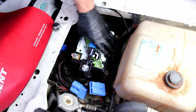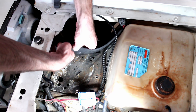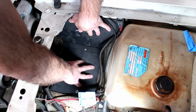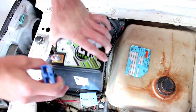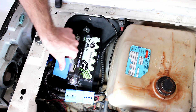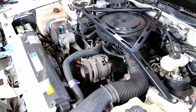The battery holder fits and works well. Since I don't have any fender liners, I made some ABS plastic shields to keep water away from the battery — a lithium battery, like most batteries, does not like water. The bottom plastic piece covers up the ugly rusted metal, and some sheet metal screws keep the side plastic in place. I haven't come up with a good battery terminal cover, so some tape will suffice for now. And man, does this engine turn over crazy fast now. I'll see you next time.